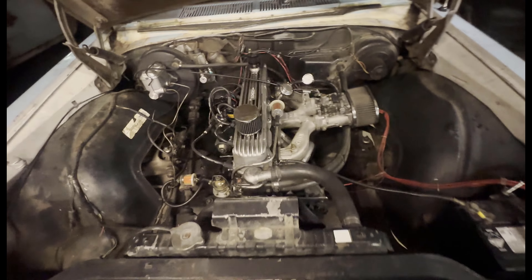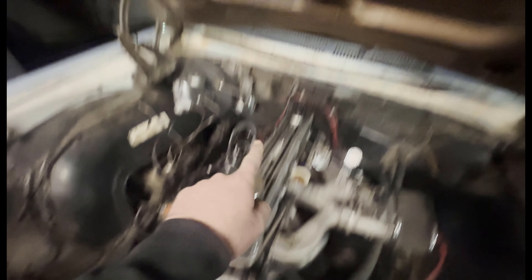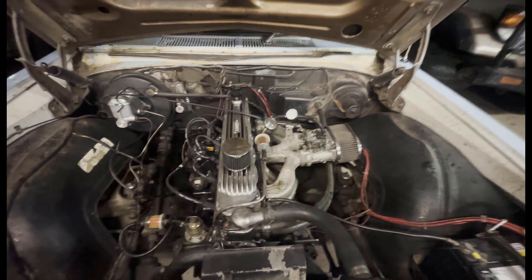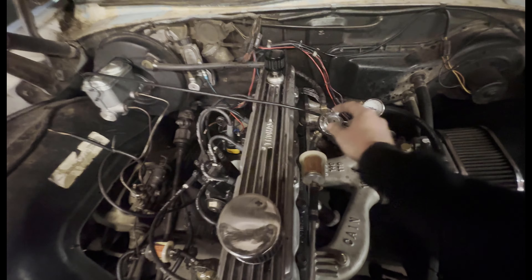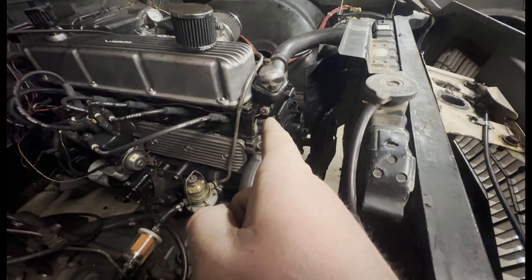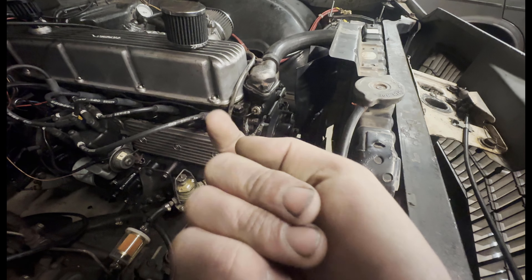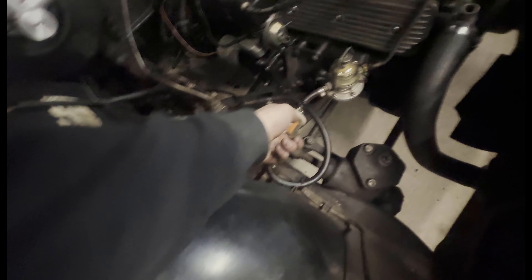It's actually been a couple of weeks since I got this back in and running. I've still got a bit of blow-by at the top. It's actually been running pretty damn good — it seems to like four pounds just a little bit better on the fuel pressure. I still seem to have a bit of a leak at the base of the thermostat. I think that's from corrosion on the bottom edge. Water pump seems sealed up, sump seems sealed up, fuel pump's sealed up. We've got new filters in there.